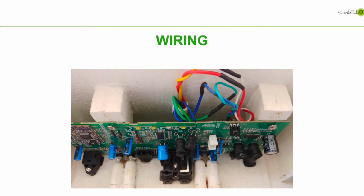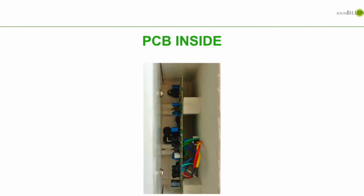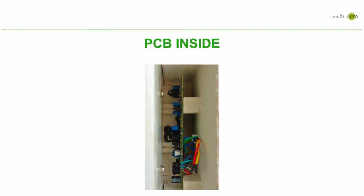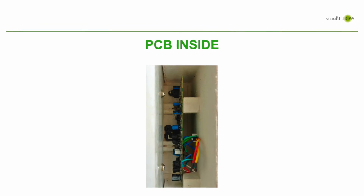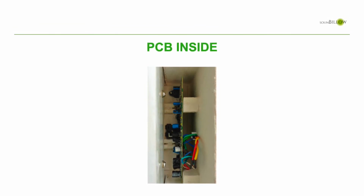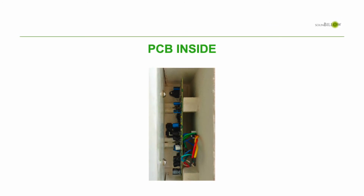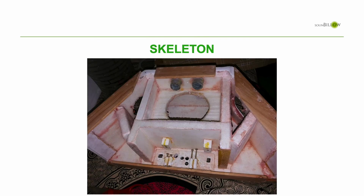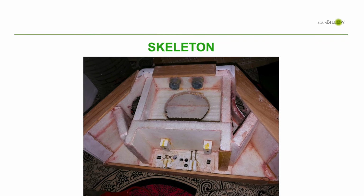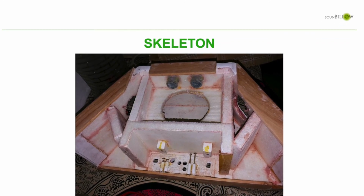The sound level is tested at room noise levels. That is how we normally intend to listen to the audio. The sound levels are recorded with a low and high of 60 decibels through 113 decibels respectively, with an average sound level of 91 decibels, which is interesting for such a device built to produce 30 watts of sound output. The device is about 3 feet away when the sound levels are measured.